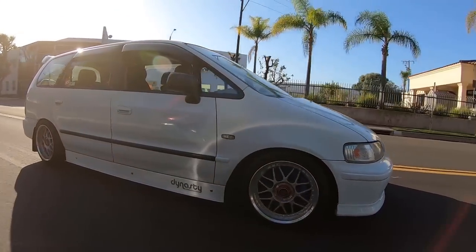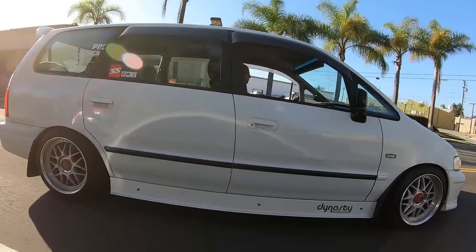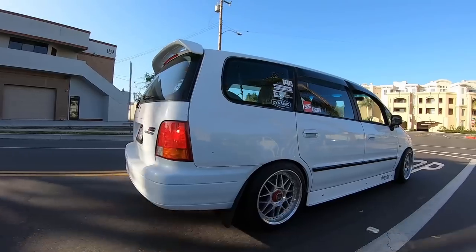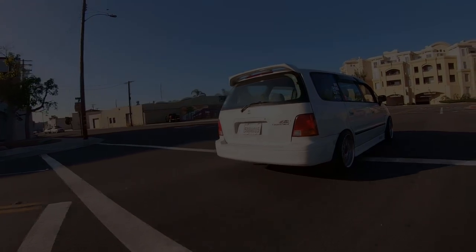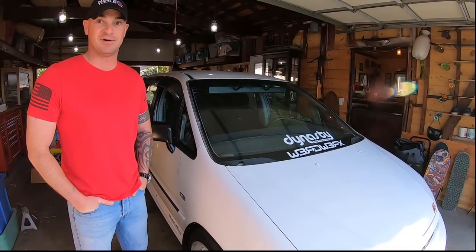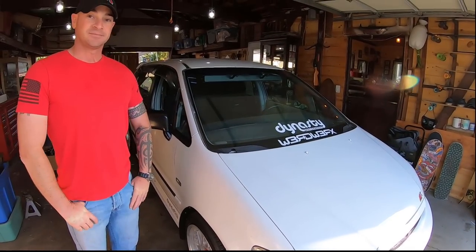I figured it was reliable, and I think it's been eight years since we put the last engine in — this one has not died. Although I will say it's coming to its last legs and is ready for a rebuild. I think the head gasket has a slight leak that seals itself once it gets hot, because I'm getting just enough oil in the coolant to let me know it needs work. But it makes power, doesn't overheat, and I can drive it as hard as I want.